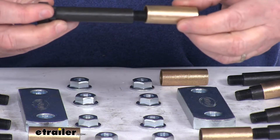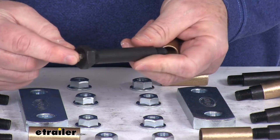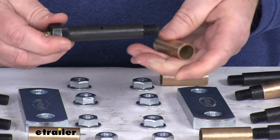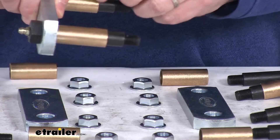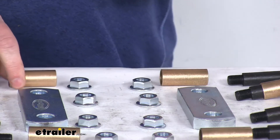When this is installed, your bushing will go right over the bolt. When you pump the grease in, there's a hole right here — it goes through the bolt and comes out that hole, applying grease inside your bushing. So when the shackle is moving, everything will be lubricated to prevent wear.